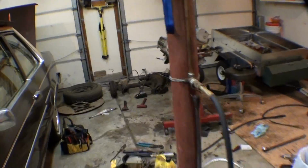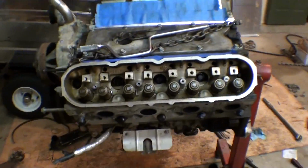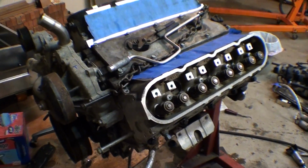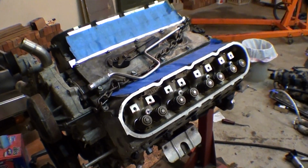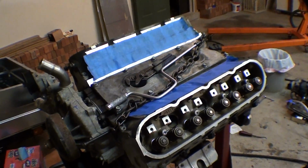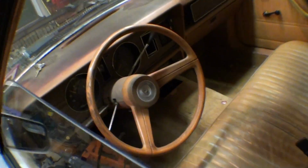On top of everything, I put a ZR1 cam LS9 engine from the new Corvette with the supercharger into this motor. We put it in my buddy's 4.8 turbo truck. It works pretty damn good. We picked up about 50 to 70 rear wheel horsepower with identical amount of boost from before, so once all said and done, should be good.